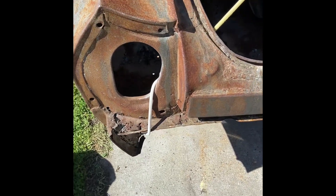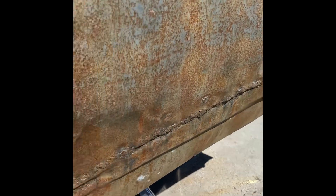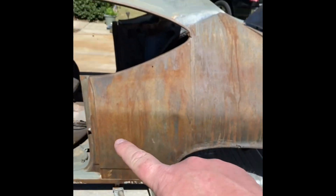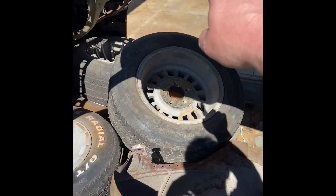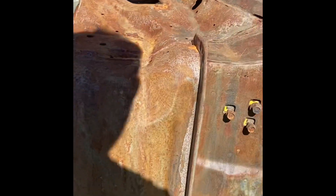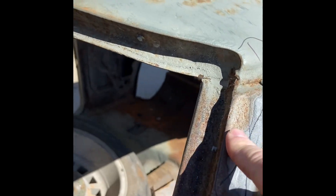On the driver's side I see a bunch of cancer here I ain't even touched yet. I'm just going to have to probably end up putting a new panel down in here. This quarter — I'm just going to have to take an L on it. I'm going to have to put a whole new skin on the outside of the car from here to there. You can see where these random holes were drilled where they tried to pull the dent out but it didn't pull. I'm going to delete this drip rail over here too. I thought about repairing this but I really don't think I can — the damage is just too much. So I'm going to have to put a lower vent panel on here. But I did manage to clean up some of this stuff and I repaired this here — this was really torn up pretty bad. So I repaired it. I've got a lot of repair stuff to do here, but that's what I've done so far with Patches, guys.